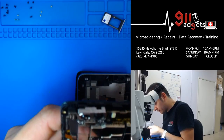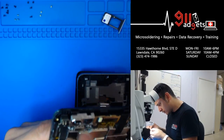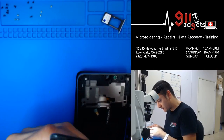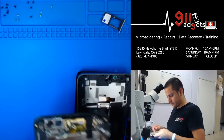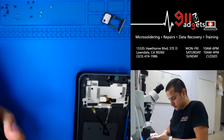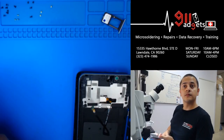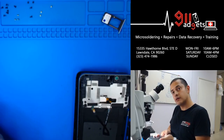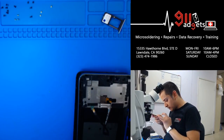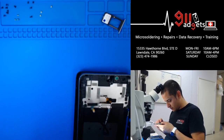Now let me see this real quick. I don't know if I unplugged the battery or this LCD cable, but it was kind of unplugged. I may have done it with the plastic spudger, but let me go ahead and plug it back in. Oh no, there's definitely a short in there. This thing smells burnt. So that tells me that the motherboard could be burnt. We don't know yet.